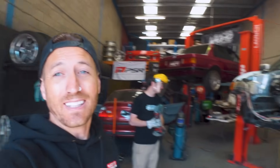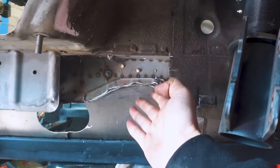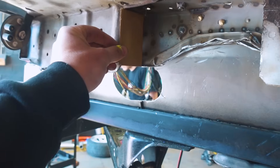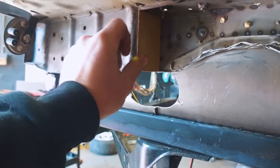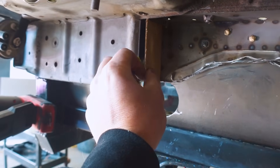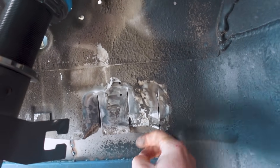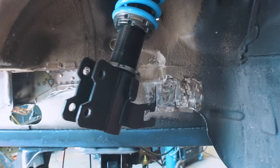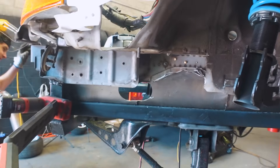All right, we're on day three of this video now — this stuff takes so much time, so much attention to detail, so much measuring. Right now I'm boxing off the areas that we have cut out. It looks a little bit average right now but we're going to make it look prettier — I've already rounded off the corners and we'll do all of them to make it look super nice. Then it's back to templating with cardboard: push a piece of cardboard in against the surfaces to make the marks, cut it out, and that becomes the template for the metal piece we're going to weld in. For the back side, we cut slits, cut a piece out from the bottom, bend the bits up, weld it all nicely, and once you've done the under seal you won't even notice. Nathan's doing all the grinding and disk work while I make the templates.